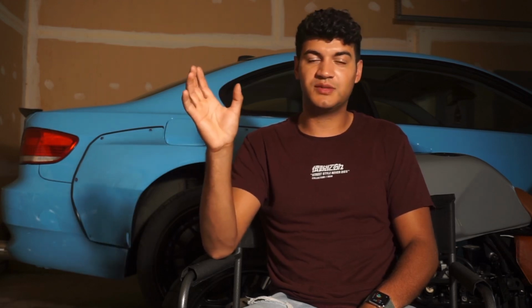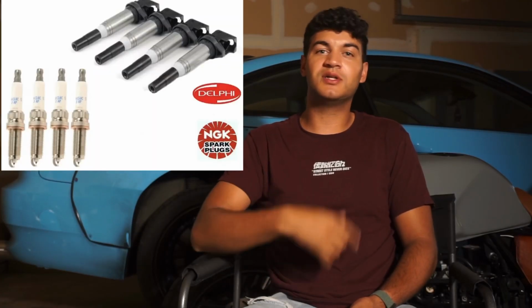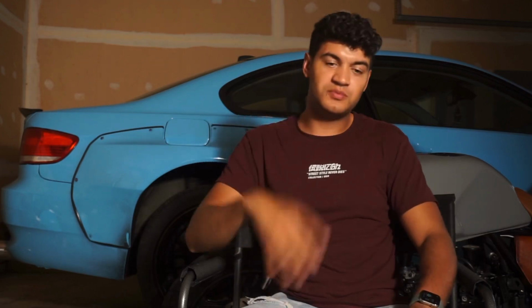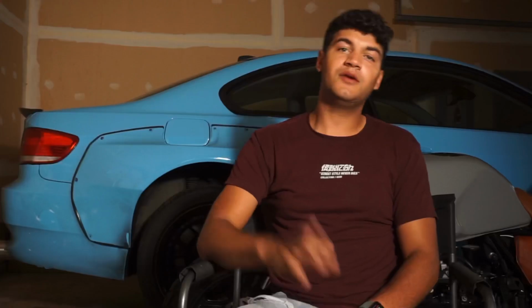Now before we jump into the tuning situation and everything, I should have said this first because some of you guys will just click off and be like, I'm buying a tune right now. But first thing you need to do is get spark plugs and coil packs. Spark plugs and coil packs will ruin your fun if you just go out and buy a tune, throw that on there, first pull, you'll get a misfire. Same thing happened with this like 5 years ago. It's not a fun time, trust me. Anyways, make sure that's first on your priority.